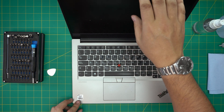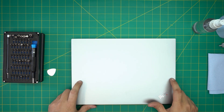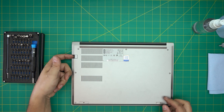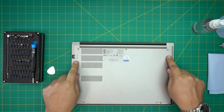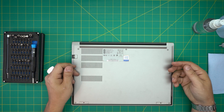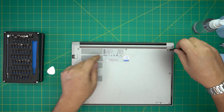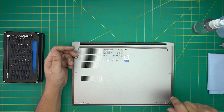With all your tools on hand, let's get started. First, power down the laptop. You're not going to modify the system or lose any files. Flip the laptop over. All the screws on the bottom have a C-lock on the end so they won't fall out. Loosen up all the screws, turning until you hear a click — meaning it's fully loose but retained.